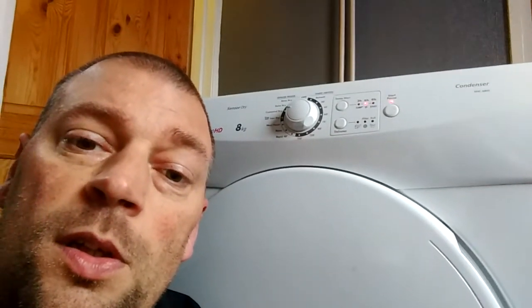If all the previous tips haven't worked for you and your tumble dryer is still showing that it's got a full tank of water when you know it hasn't, then there's one other option to look at: the location of your tumble dryer. A lot of electrical equipment won't run properly if it's under 5 degrees. Mine's been outside in the shed and we've had some very cold conditions — there's a little bit of snow on the floor right now. So I brought it inside, left it to warm up, and as you can hear behind me, it's running perfectly. I did nothing else other than just bring it in and warm it up.